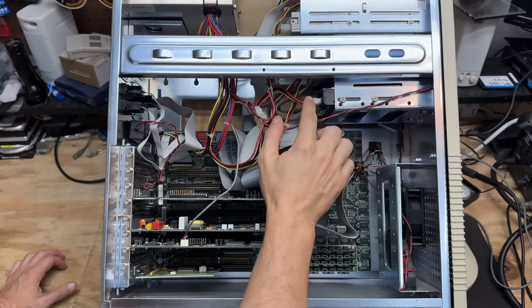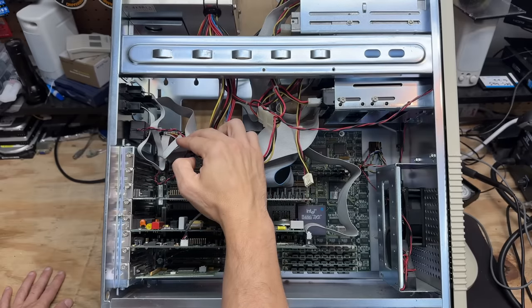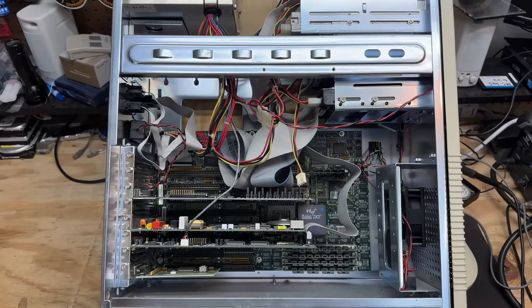And I'm very, very pleased to see it uses an external battery pack instead of a barrel battery — no corrosive board destruction here. And that's a 486DX2 board with two VLB slots, fully loaded with 72-pin SIMM modules. Yeah, I'm getting excited. Okay, let's start tearing this thing down.